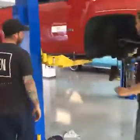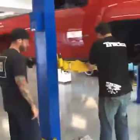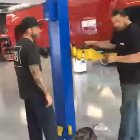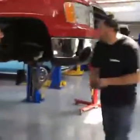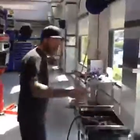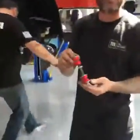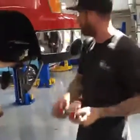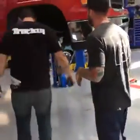So these are our nuts. Ready for the spindle? Yeah, we ditched the sway bar end links before we went live, and they come with new ones. Oh, so it comes with replacements. So this kit gets rid of all the old bushings and goes to urethane for the sway bar. This is the end link for the sway bar, and that's supplied also with the kit. You can just leave that all loose, put everything back together, and that'll be the last thing to tighten up.